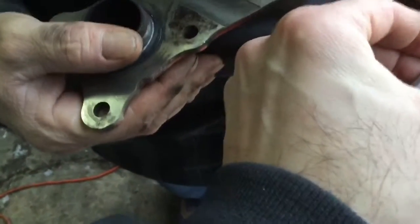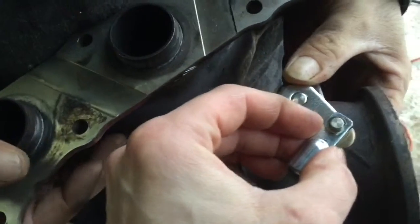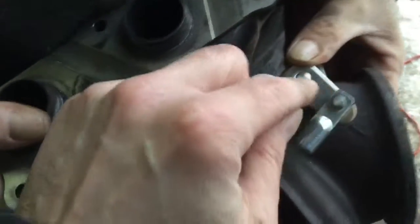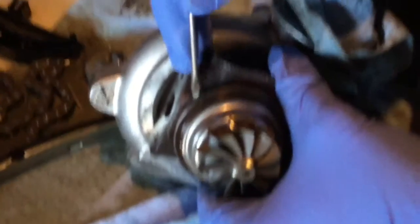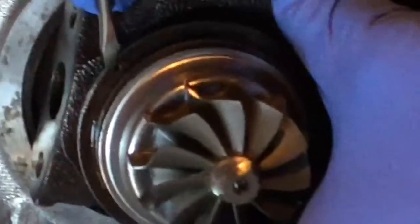So then you close the gate inside, you realign this new component here, you realign it like that with the line. When it's in closed position, just weld around and it gives you what you have right here, and this is done. So when you want to put the turbo cartridge on the exhaust, that little hole here is lining up with that little pin here.